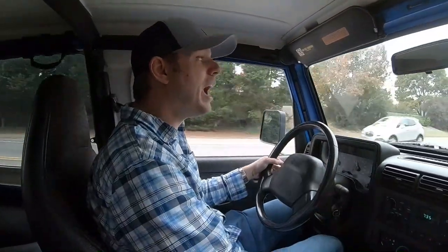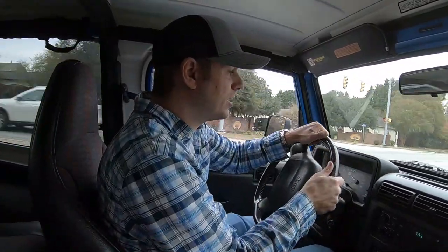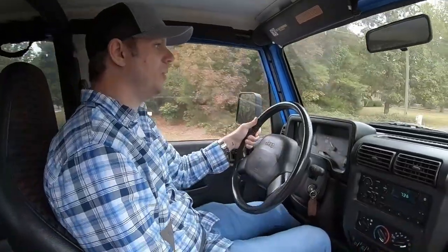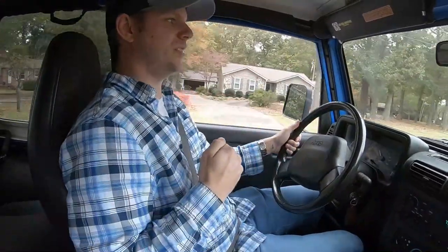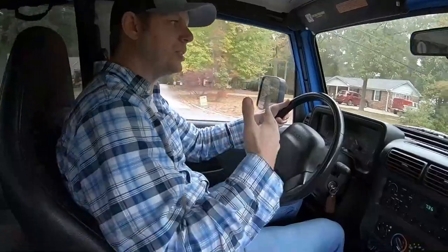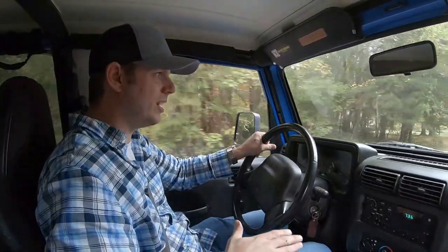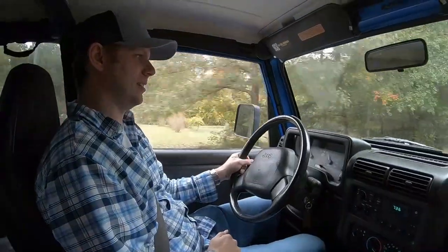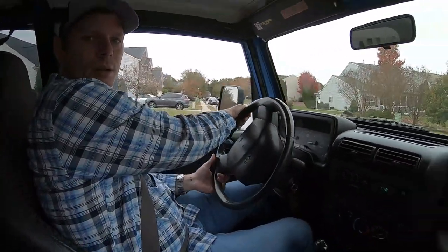Same thing when you're on the highway cruising in fifth or sixth gear — don't try to pass somebody in that gear. It's not a passing gear, it's a cruising gear. Think about it: in an automatic car cruising on the highway, if you floor it, the car downshifts at least one or two gears to put you into a passing gear. You have to think the same way in a manual. Don't leave it in fifth or sixth and floor it — you're putting too much strain on the vehicle and it's not going to go very fast. Downshift.